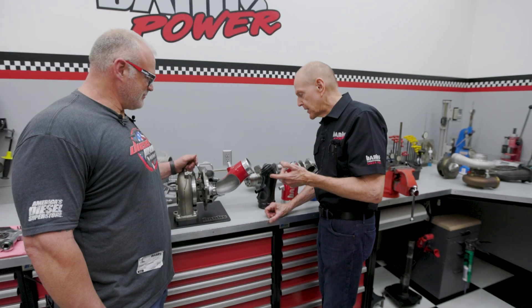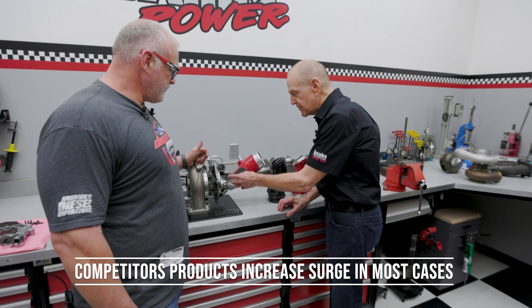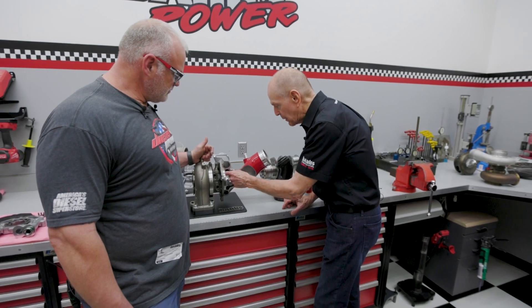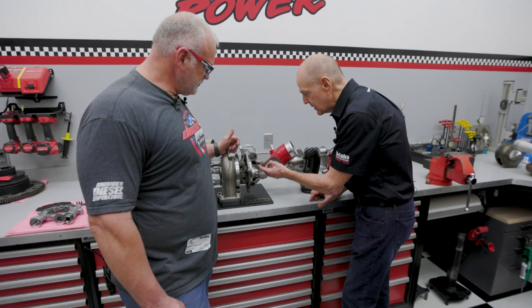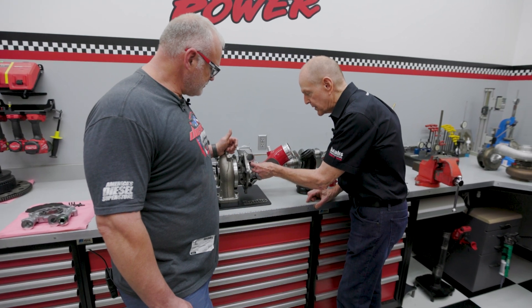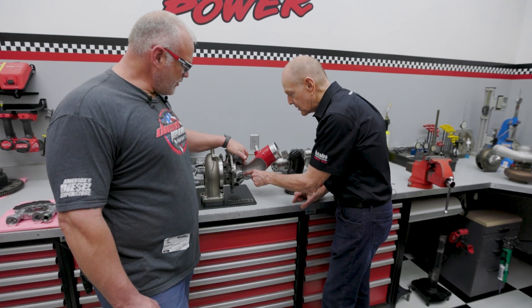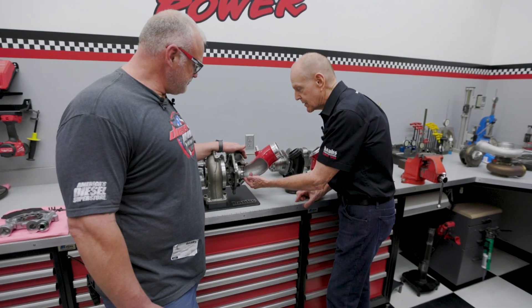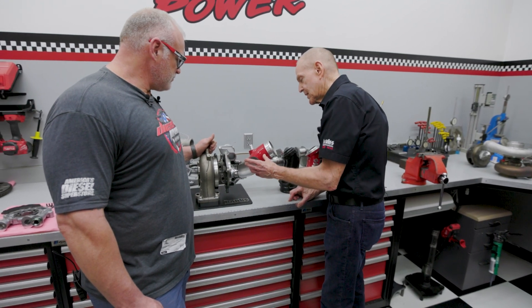We were testing on the dyno some competitive products which increase surge and, in a lot of cases, defeat the surge system. So what happens is the air comes back into the wheel, flows backwards through the wheel, and there's a slot right here into an annular chamber that goes all the way around. That high-pressure hot air pulse gets absorbed in there, and then it goes back into flow in the air gap outside the compressor wheel — so you're not discharging it back onto the compressor wheel itself. Then it flows back into the system, and the system protects it from surge.